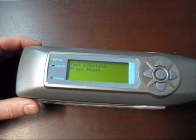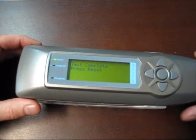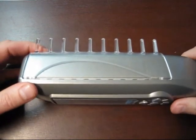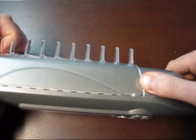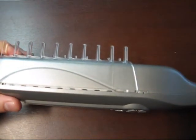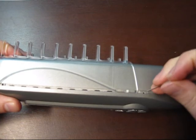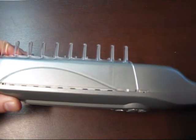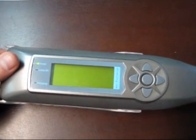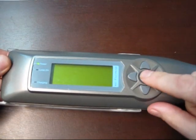At the end of the base test, we need to perform a hardware reset, which is performed by turning the lamp to its side and sliding the comb out a small way. There's a small hole here which is the hardware reset button. Press it with a paper clip or a similar instrument, and DERMARAY UV is now reset.